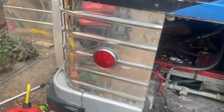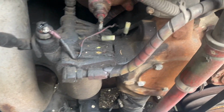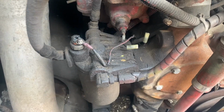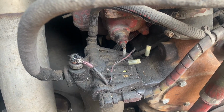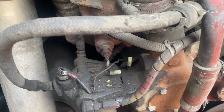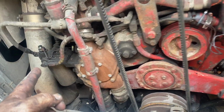All right, got the master switch on up front, and I kind of got my fuel shutoff switch jerry-rigged a little bit. I managed to crack this little piece off, because I thought it was loose, so I kept tightening it down, of course, and then it just popped off. So all this has to do is, I believe, touch ground. That prevents over cranking. But I think this actually doesn't even require that safety. So maybe I don't even need that thing anymore.